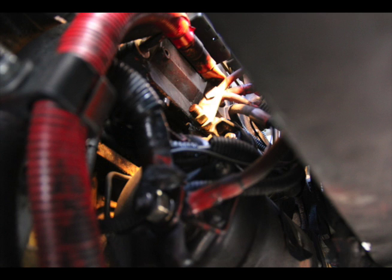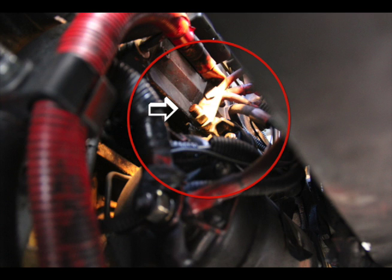The next step is to locate the starter on the truck. As you can see, it's quite difficult to get to, but there it is. You can see the terminal connected to the starter solenoid positive lug. For this installation, we are going to keep the existing wiring and add a new 4-0 gauge cable from the starter solenoid to the ESM Starter Plus terminal.